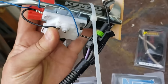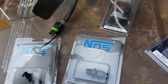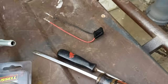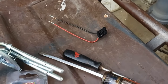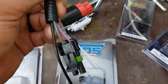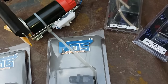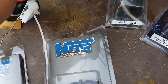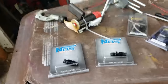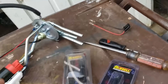On my factory pickup I have my Kemso fuel pump zip-tied here, and I'll take a little hose and make it up to the pickup. The plug on my factory sender isn't right, so I will solder the Kemso plug on here. This has the ground and the wires for power to the fuel pump already on it and it's already labeled, so you can just wire it up the way you need to. One wire is for the gauge and one is for power to the fuel pump.